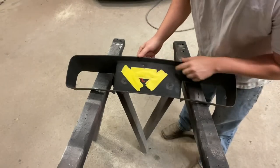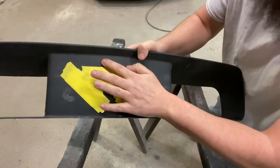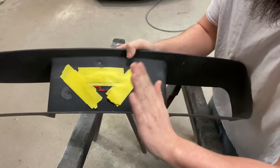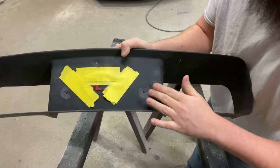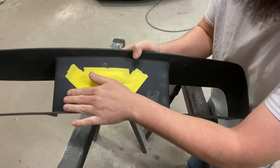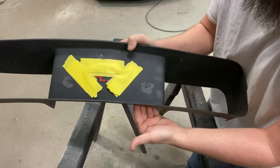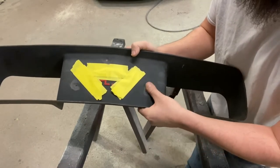Okay, as you can see, well, I don't know if you can or not, but I've got fiberglass from the back side, and I'm down to that on this side. There's a little pulled up area down here on each one, maybe a 16th of an inch deep. I'm gonna be able to fill that with that long hair resin fiberglass, which will connect the backside filler to the top side, and this will be a seamless repair, super strong, and it won't ever come back on you.